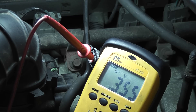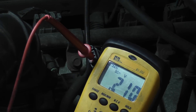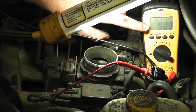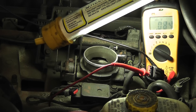Next step, I'm going to unplug the MAP sensor, which is up top. If that doesn't do it, then I'll unplug the cam, then the crank — those are our 4 sensors. I've located the MAP sensor. Notice I haven't moved my multimeter off the TPS; I'm still measuring at the TPS because they're all sharing that same reference circuit. In the process of pausing, my voltage actually got lower on my reference circuit — I'm at 0.009. I'm going to unplug the MAP sensor and watch my voltage. Voltage came up a little bit, but still not 5. So TPS and MAP are not shorted. Cam and crank are next.